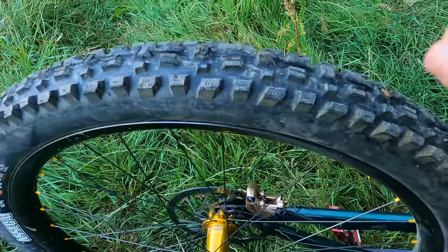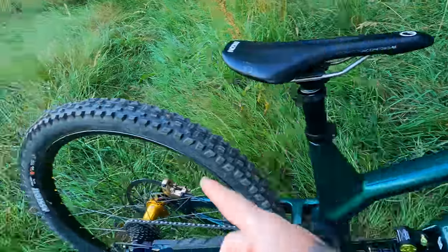Regarding tyres and inserts, I went for Assegai downhill casing front and rear, with XC Cushcore inserts inside. The Cushcore cross-country was something I'd always wanted to try, and this felt like the perfect event to try them out. They're a little bit lighter than the Pro version but I felt like they did the same job. I ran much harder tyre pressures than normal - about 28-29 PSI in the rear and 25-26 in the front, whereas I'm usually under 20 with the Pro. I didn't want any tyre roll or fold on the take-offs, because we were hitting them so fast and steep.